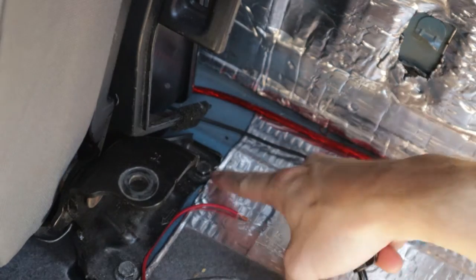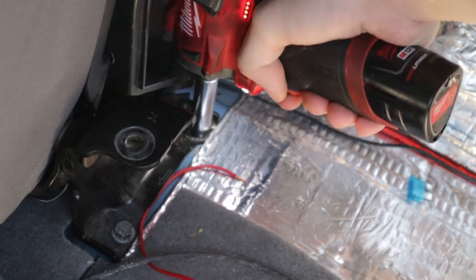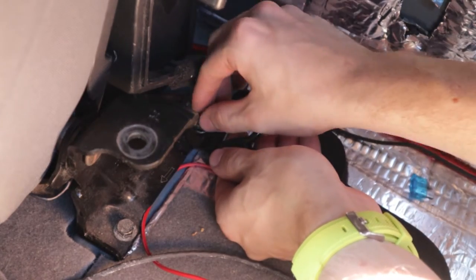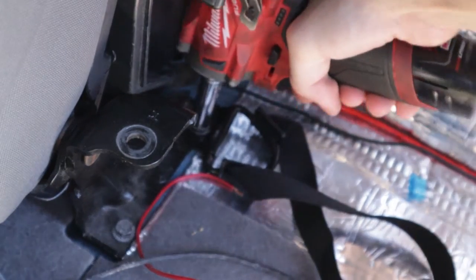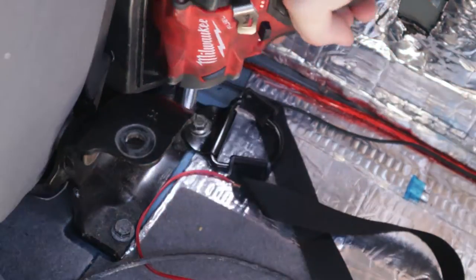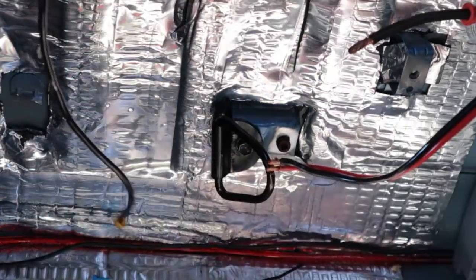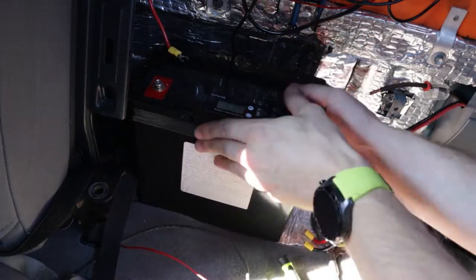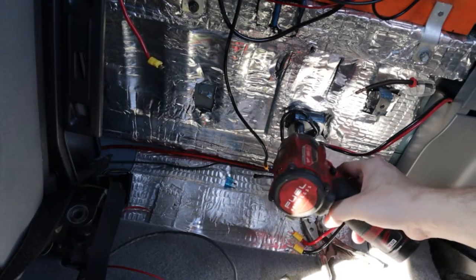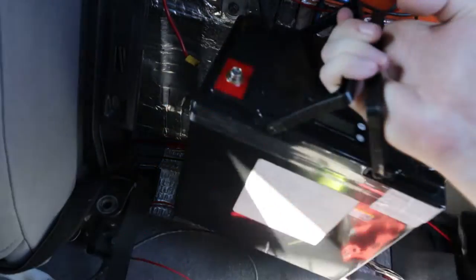You're ready to mount a battery — let's do it. Take this bolt out and put a D-ring in its place, just like this. Cinch it up with the velcro straps, make sure it's nice and tight, facing the direction shown in the clip so everything fits perfectly. On the other side, use the 10mm bolt from your seat back. When you go to move the battery in and it doesn't fit, take it back out and flip the D-ring the other way so you have access for the lithium battery.